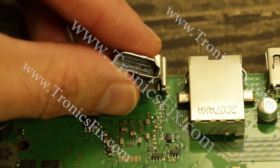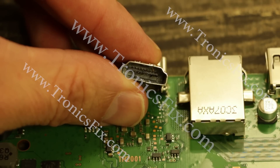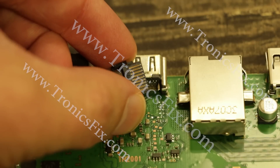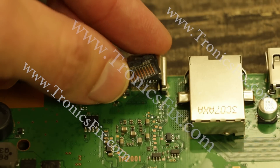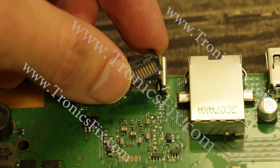Here you can see the inside on the front of the PS4 — this is what you would see if you were looking at the back of the game console. You can see down in there those pins are smashed up because they've come loose from the plastic piece inside. Each one of those pins corresponds to a pin on the cable that you plug in, and the problem is those little pins are not attached well to the plastic piece. So when you push the HDMI cable in, if these pins are up just a little bit it can pull them right up and smash them against the back, and that will cause your problem.